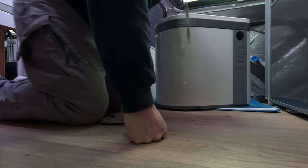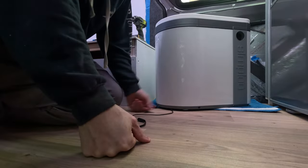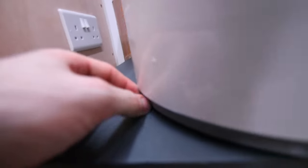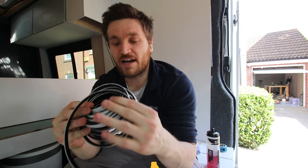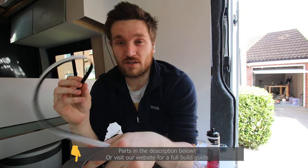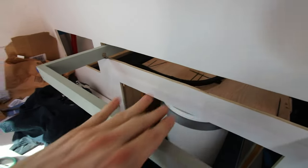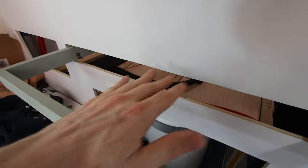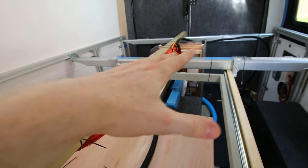It's like a mini household toilet — it looks really modern. The seat comes up as normal, springs up like that, and the 12V fan is underneath. It comes with tiny little feet that you flip out underneath. I've got some draft excluder material — it's actually used in the cabinet-making industry. I'm going to place it just inside here on this lip, so that when we push the table in, if there's anything like crumbs or liquid on top, it's going to keep it this side and drop down the front, rather than going past the back and potentially dropping onto all the electrics. That way I'm keeping the electrics safe.